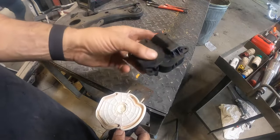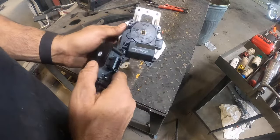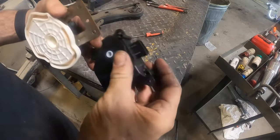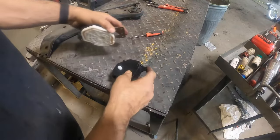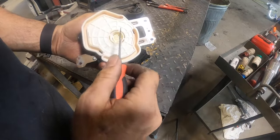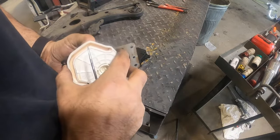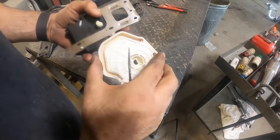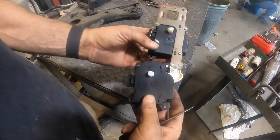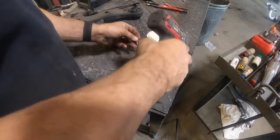This is the new one going on - it's aftermarket, I'll put a link in the description below. I wasn't able to get one from the dealer because they said it was on national backorder. Let me show you how to take it apart: there's a tab right here that locks into the new one. I've broken many of them over time, so be gentle. If you do break it, it's not a big deal - just glue it with epoxy. Pull that tab up really gently and it comes apart. It can only go on one way. Don't put it on just yet because you've got to put the bracket on first - make sure your connectors are going the same way. There are three Phillips head screws.